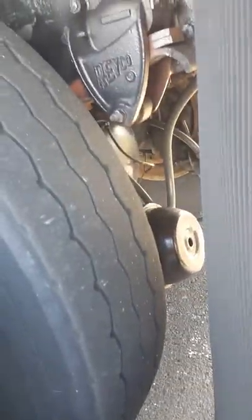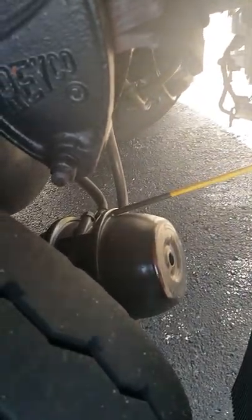Moving to my brakes — back here I have two brake hoses. I'm checking both brake hoses — they appear to be securely mounted at both ends, they're not rubbed, chafed, spliced, or damaged, and I hear no audible sounds of air leaks out of my brake hoses. That takes me to my brake chamber — my brake chamber is securely mounted.